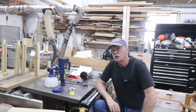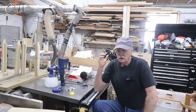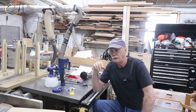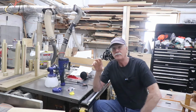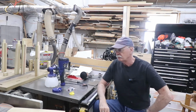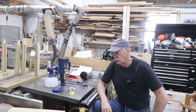I've sprayed years ago using siphon spray guns for cars and things like that. They, at the high end, run at 50 psi. I can't remember how many CFM that is, but 50 psi. You get much finer droplets with that, but the downside is up to 70% of your paint product can wind up in the air. So that's why you need a spray booth or something akin to a spray booth, or don't shoot in your garage.